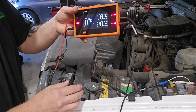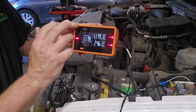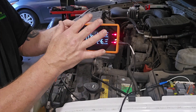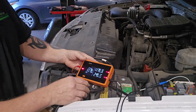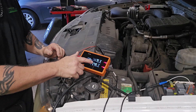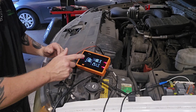When it's green, that means the ground circuit is correct and it uses the battery. This is better than a multimeter or a power probe — this loads the wires, this does everything. So now we're going to do a wiggle test while this is hooked up, while watching this, to make sure that LED never turns red.